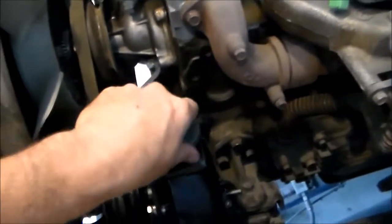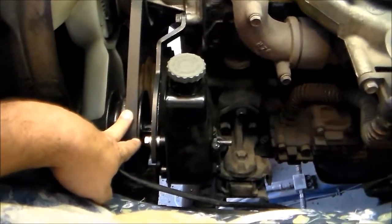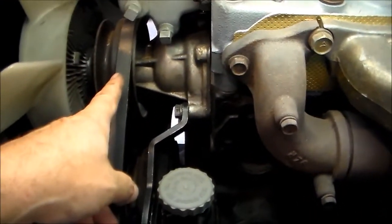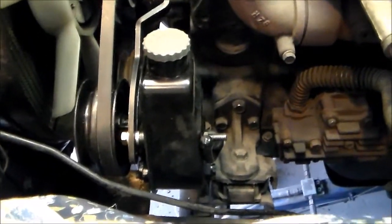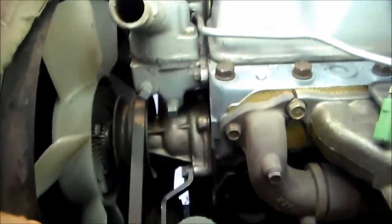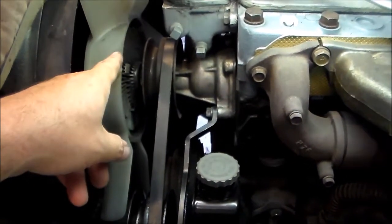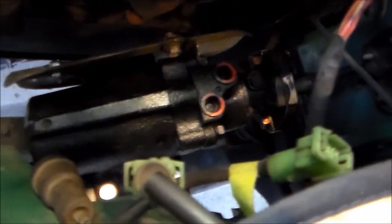Now that I've got my pump mounted with the adjustment bracket in place, the power steering pump is where it should be and my belt is all in place. I made sure my belt lined up with the lower pulley and the water pump, and the pump is in a nice perpendicular vertical position — all tightened up. I do need to get another belt for the alternator since the one I have isn't the right one, but once I sort that out, I'll put the outer belt on, tighten the alternator, and then the next step will be running the lines from the pump to the box.